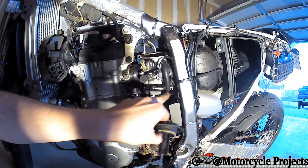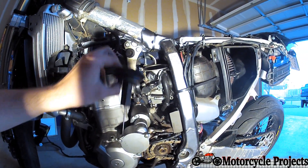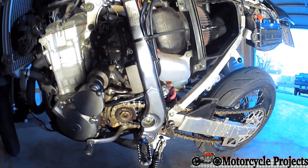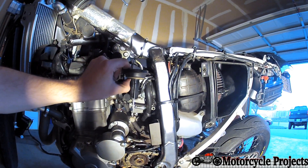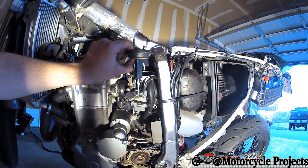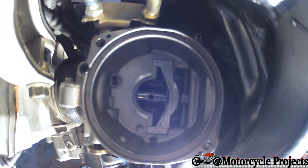From the air box, there's a hole in the front of the carburetor that has an air passageway that lifts up and blows air up into the diaphragm. At idle, there's enough tension from the spring sitting here holding the diaphragm down that nothing happens. But as the RPMs increase, so does that airflow, and it counteracts against that spring. So this inflates like a balloon and lifts up, which lifts that needle, slowly pulling it out of the orifice tube. You may be able to see it down in there — there's a small hole at the bottom of the slide.